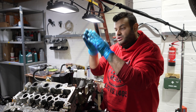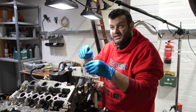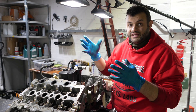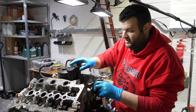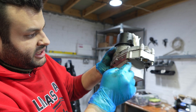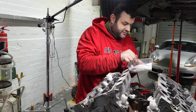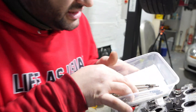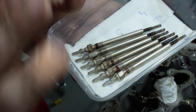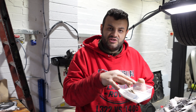In petrol cars they have spark plugs; here they have glow plugs. Because petrol combusts with sparks, but diesel combusts with heat and compression — that ignites the diesel, which is completely different. Glow plugs, from right to left: one, two, three, four, five, and six. The coloring is different — look at number two, it's slightly not darkened. But the colors look okay overall. I feel like they all look okay, but let's number them just in case so we can put them back correctly.